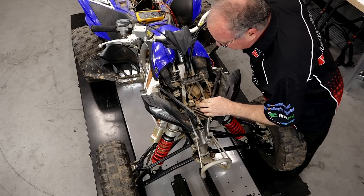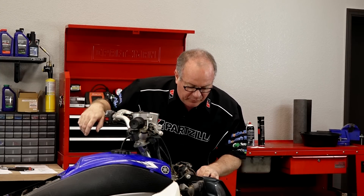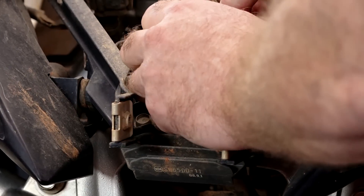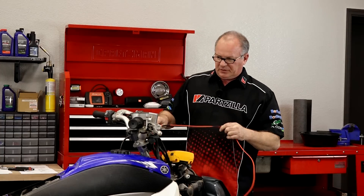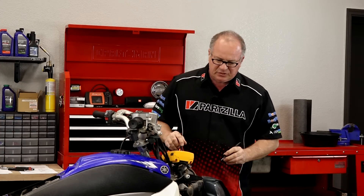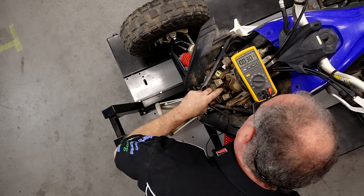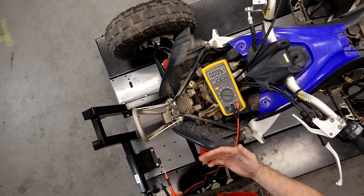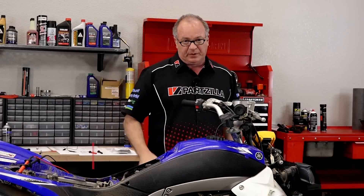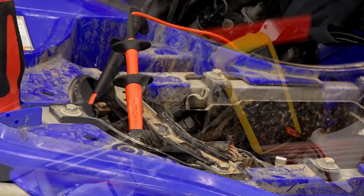Basically what you have here is five wires coming into it. The ones at the top — one red and one black — that's the charging circuit that should be going back to the battery. I want to unplug it and make sure I see 12 volts. The other three are actually the ones going down to the stator. We're at DC voltage and we should see the 12.5-ish measurement. Reading 12.7, so that is it. We've done all the tests I would normally do. According to the Yamaha manual, they usually don't recommend the diode test, which I've done — and they look okay — but it's still not charging. So what Yamaha says to do is just go ahead and replace it. That's what we're going to try next. I've got the voltmeter hooked up — let's see what happens. Flipper on, run position, start her up.